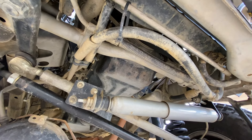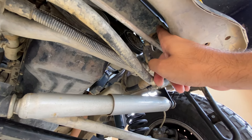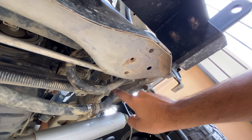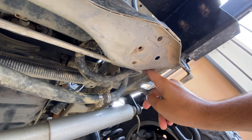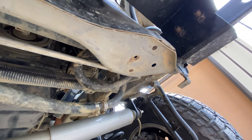Before moving on to the winch, some of you are probably wondering if I have the aftermarket transmission cooler connected to the radiator or if I bypassed it. I didn't bypass it — I have them connected together. You have your two transmission lines running here. What I did was disconnect one line from the radiator, connect one hose from the transmission cooler there, and connect the other end of the transmission cooler back into the radiator. So all I did was add the aftermarket cooler in series between the transmission line and the radiator. Pretty simple and really straightforward.